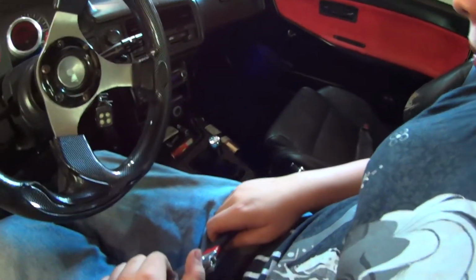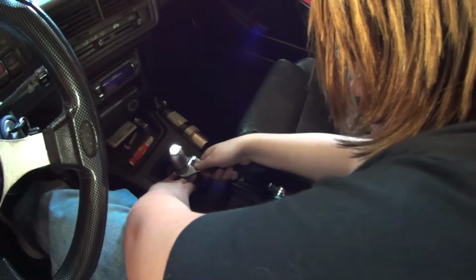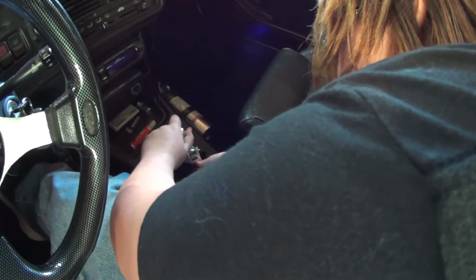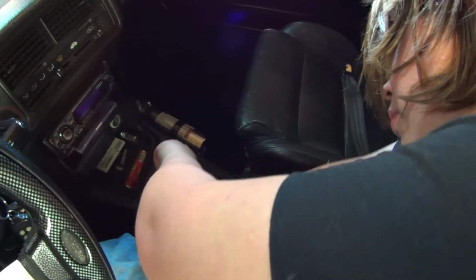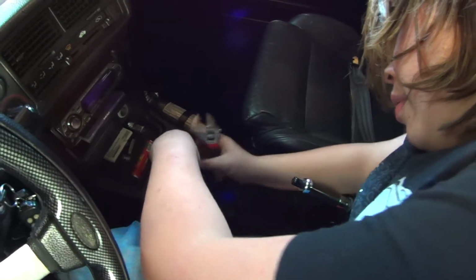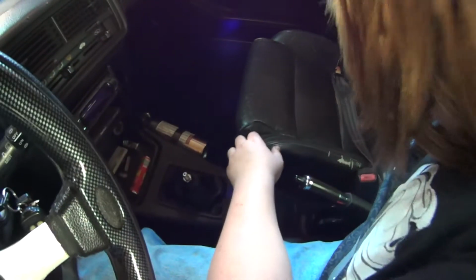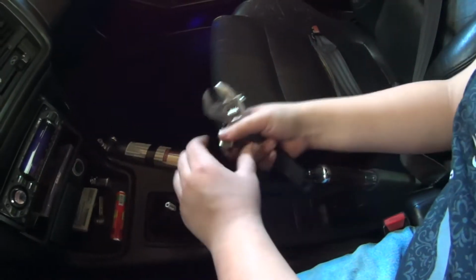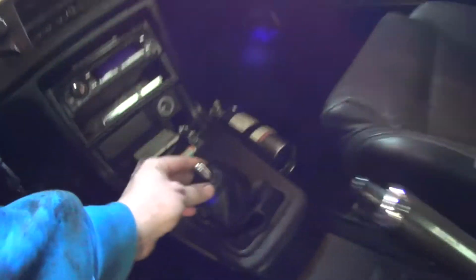Okay, like so, on the shift knob there, see how there's a nut underneath the shift knob? Got it on there? So to loosen it, you're actually going to turn that to the right because you need to spin the nut down on that shaft. So you're going to pull it towards you. Hold the shift knob still while you turn the nut. You going? This is spinning with it. You got to hold the shift knob really hard and still to break that nut loose. There it goes. Oh, I got it. So now you have it loose, you just need to unscrew the shift knob. This part? Yep. Okay, just lay that in the seat. Now you need to take the nut off, so just unscrew that by hand. Good. That's it. Good. So now, we should be able to just drop that down if I remember properly. I'm not 100% sure.